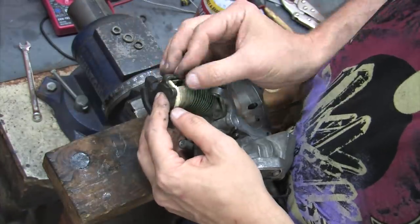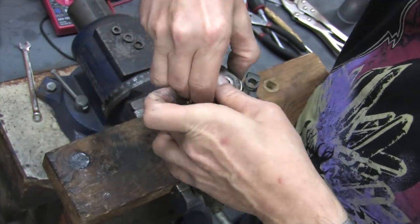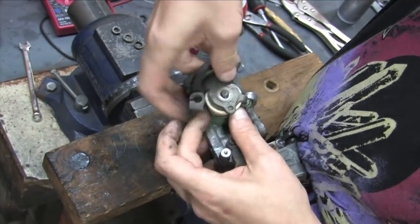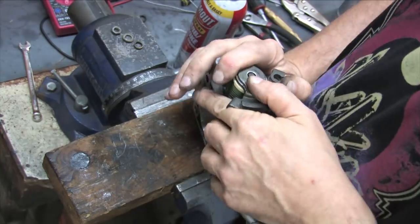If you get crossed up and have to reset your grip, back off until you can line up the slotted linkage with the throttle shaft, and it'll hold it all together until you've reset your grip. Good luck keeping that sandwich stacked together, though. You'd think I'd be smart enough not to hold it in my hands while winding springs.